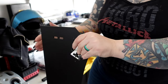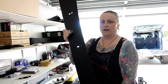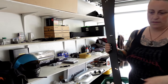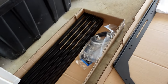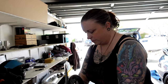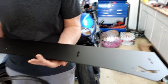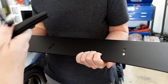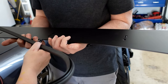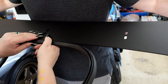The other thing we have to do before we can actually start assembling things is take weather stripping — this is my deflector. The weather stripping needs to come along this edge right here to help with wind noise, which the Bronco has already got plenty of and does not need more of. So the gasket — we are folding over in half, approximately, putting it in the center and moving it out from there, as Trail Racks kind of instructed.